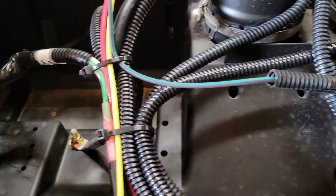Hook up those two wires — they interface into the harness and everything runs up through this turn signal switch. It's a nice heavy-duty unit, just held on with a hose clamp. You do have to be careful with this style tilt wheel — it's very close and sometimes it may rub. There is an alternate procedure if the turn signal switch interferes with your steering wheel on the tilt column.